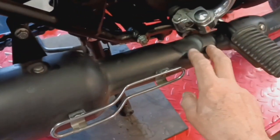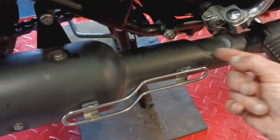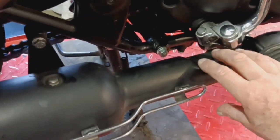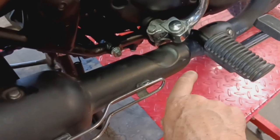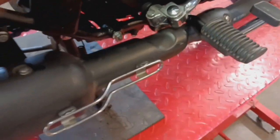The second thing: I've had a most appalling rattle. The only thing I've been able to trace it to is this part of the exhaust heat shield. If I tapped it even lightly before, it rattled terribly. Underneath there's a hook that secures this end of the heat shield. Removing the heat shield by removing the four bolts and sliding it forward to release it from the hook — the hook was probably not engaged, sitting underneath the slot. A bit of tweaking with that has got it secured and now there's no rattle.